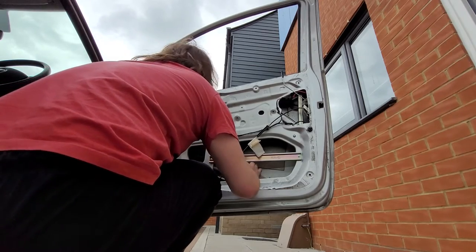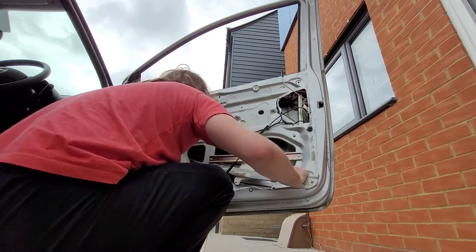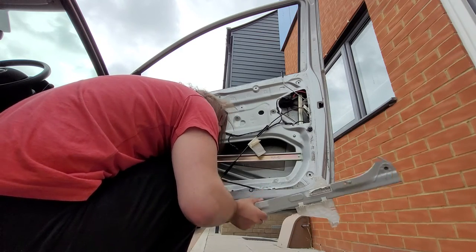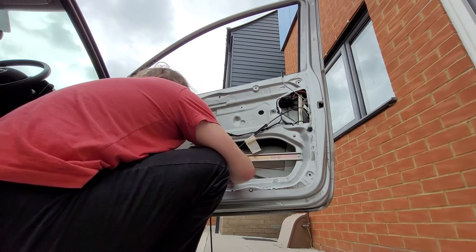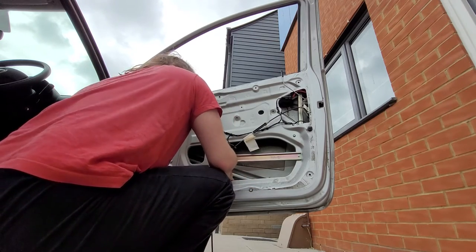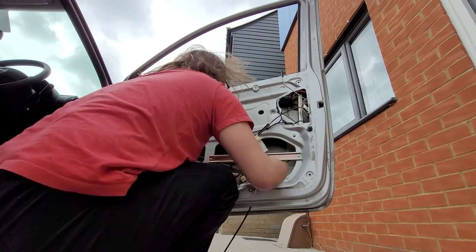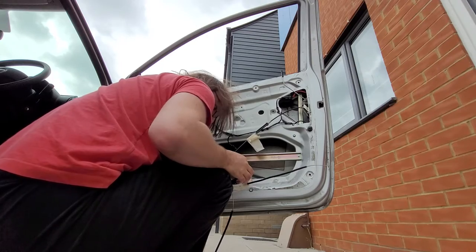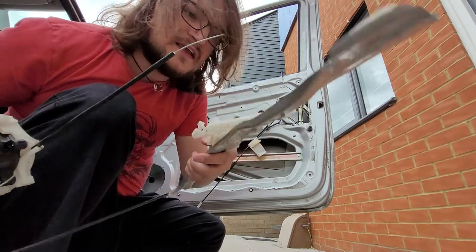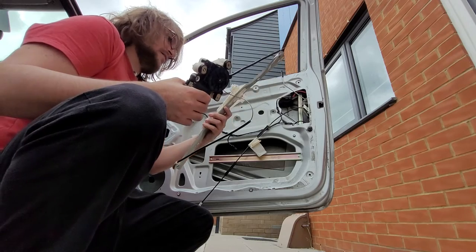That's one part of the system removed. Now we've got to get this out. I'm hoping I can slide it out through this hole here. Yeah, you can see what happened - where it all snapped. The trouble is these are only made out of crappy plastic. Here is our window mechanism and here is the part that's failed. You can literally see in there the cable has snapped. Good luck trying to fix that. And then there's another one there that looks like it would have failed too.